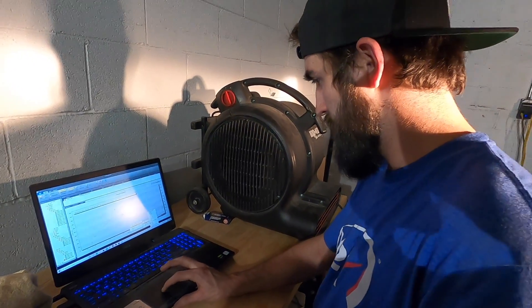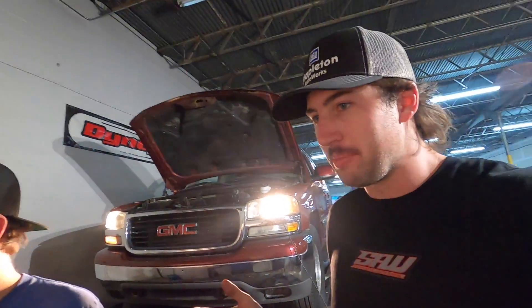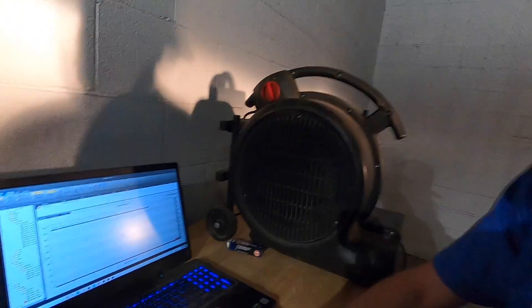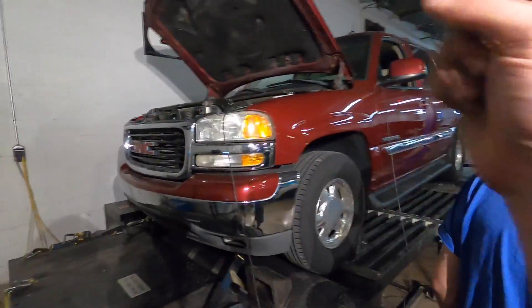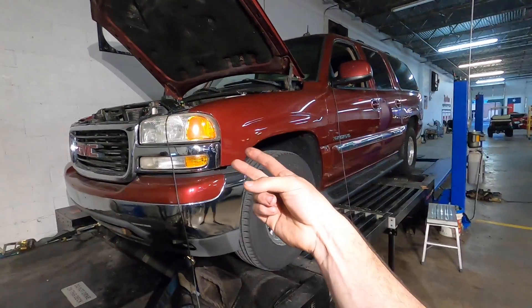Man, that's a lot of power for basically just a turbo kit I built on jack stands. That's like 5,900 to 6,000 RPM right in there. The big peak torque win — peak torque is at 4,000 RPM — that's pretty much right when the converter is coming in. And that's on 93 pump gas, a turbo kit I built on jack stands, with a turbo that I believe is less than $800. Mine's actually a pre-production unit, but they're for sale now on forceperformance.net.